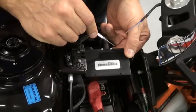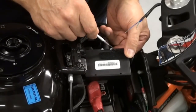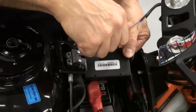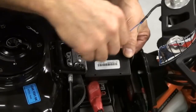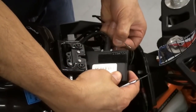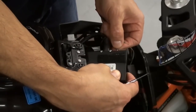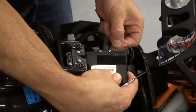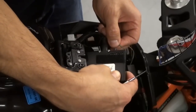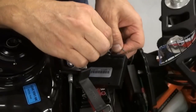So the only ones that you need to worry about, again counting from the middle out, are the third and the fourth screw. So you're going to loosen those up a little bit, and take the quick shifter wires and push them through the holes in the back, like we mentioned in the wideband video. Make sure you're putting them in the right holes, 3 and 4, and push them till they hit the membrane, and then they'll pop through, and you should have almost no exposed solder.